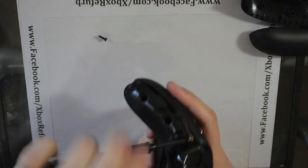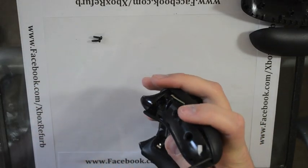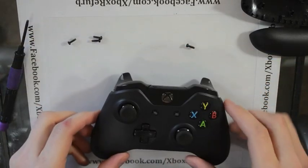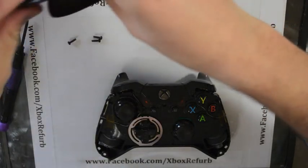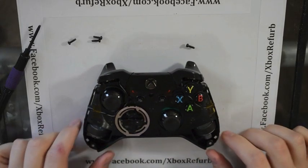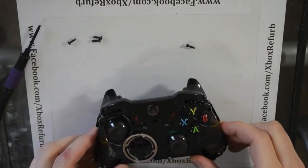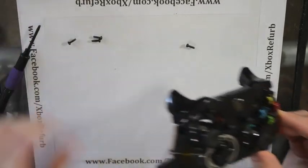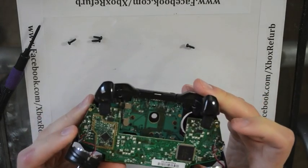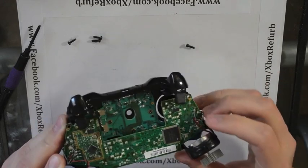Pull those screws out. They're actually extremely simple to take apart — changing thumbsticks in the future will be extremely easy. You can see on my Facebook page where I already put PlayStation 3 style thumbsticks on the controller with the paddles. Once you get that apart, the faceplate just lifts off and you get the exposed inside. From here we want to get to the guide button, so we'll continue disassembling. The whole inner section lifts out, leaving your bottom part. Set that to the side — this is your main board. Unlike a lot of other controllers, this is a little more technical: we have rumble motors in the triggers on the bottom, and two different PCB boards that stick together.